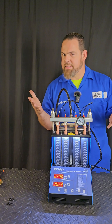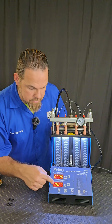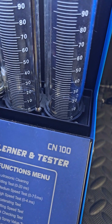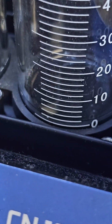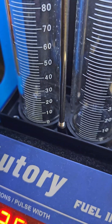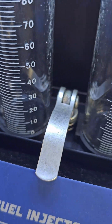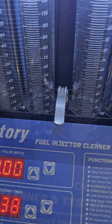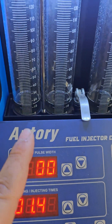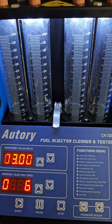This is a simulation — like if the vehicle is in idling mode. Let's wait until this test finishes, which is going to take about 10 minutes. Every time you're analyzing the vehicle's fuel injectors, the most important thing when using the analyzer is to make sure that each one of the fuel injectors is spraying at the very same rate and filling up the bottle at the very same level. They are all very similar. In the idle test, check out the level of each one of the injectors — it's exactly the same with absolutely no difference. That's exactly what we're looking for.